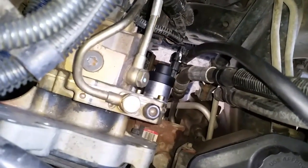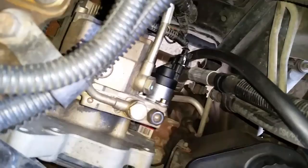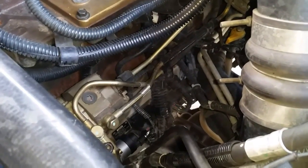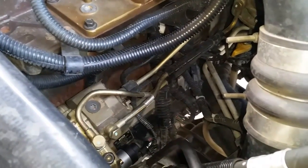That is an FCA replacement. I think that's one of the cheaper components you can throw on there to try and diagnose some fuel issues. Other parts that can cause you problems are the pressure relief valve and, of course, the injectors — both of those start to get a little more expensive. Or if you have to replace an entire CP3 fuel pump, the FCA is probably the cheapest option to start with when diagnosing fuel problems. If you have a lot of miles on your truck and haven't replaced it, it might be a good investment just to throw a new one on there anyway. A lot of guys on the forums have reported that it made their truck run a lot smoother with just the FCA replacement. Hopefully this is going to fix my problem and hopefully it will help you fix yours. Please hit the thumbs up, subscribe, and share this with your friends. This is Rob D with the FCA replacement — thank you for watching.